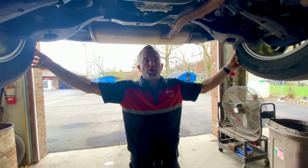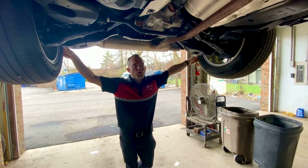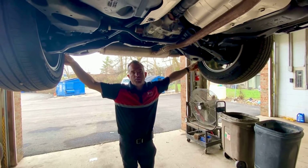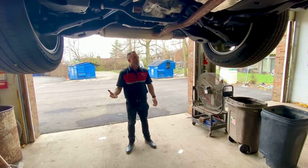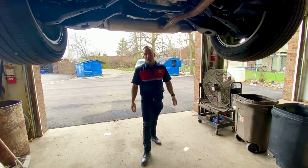This is very important to know if you have an all-wheel or front wheel or rear wheel drive vehicle when requesting a tow. And the towing professional should know this as well, and you may want to specify, but a wheel lift and dolly is acceptable. A dolly is the right way and is an acceptable way to tow an all-wheel drive or an EV electric vehicle.